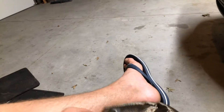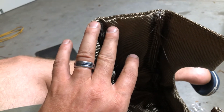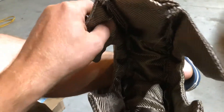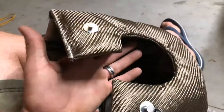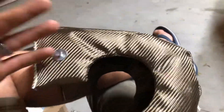Number two thing — does anybody know what this is? It's not a helmet, trust me. It's a turbo blanket. Semi-trucks mainly use T6 housings on a turbo. This is the second one I bought. Mine has a twin turbo. The first one I bought was for the higher — I think it's the higher pressure, which is the lower turbo. I have a C15 twin turbo CAT and I like to cover my snails on the turbos with these kinds of blankets because you keep the heat in the snail and you don't get the engine compartment hot. The turbo doesn't dissipate its heat out, so this actually helps a little bit.